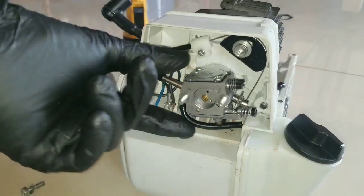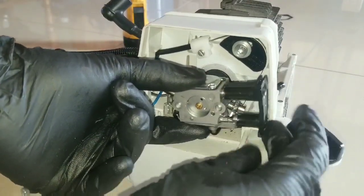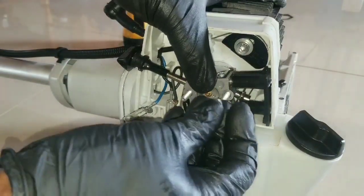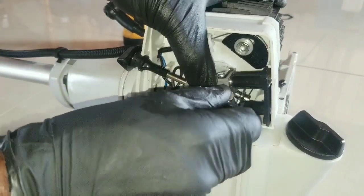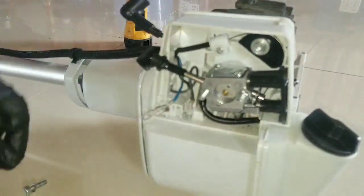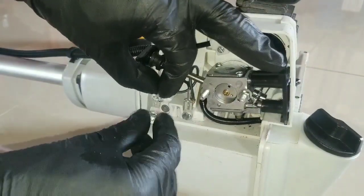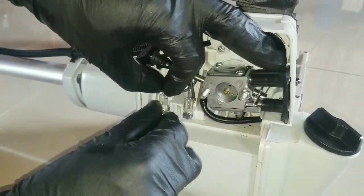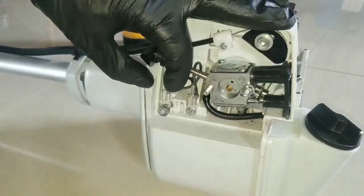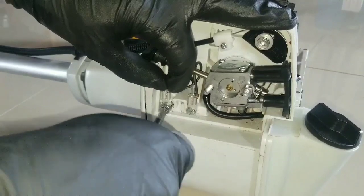With the cable in location, again, you need to slide this forward and just fit this protector duct, place it back in location, and we could place the nut on here and torque it down to position. This side here, we're going to use the screw with the medium size washer for holding the assembly for the gas tank carburetor against the frame, and this wire is going to ground the igniter to the frame.